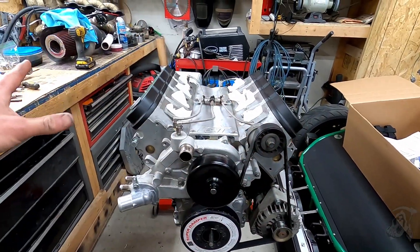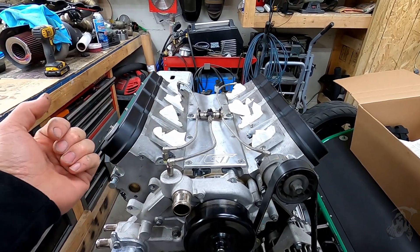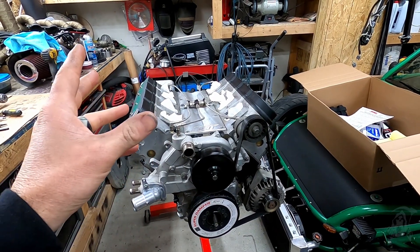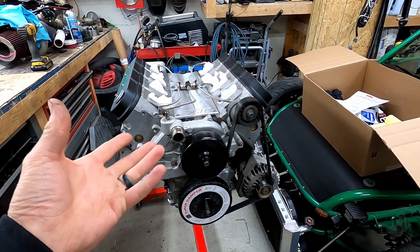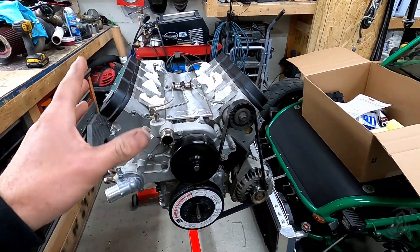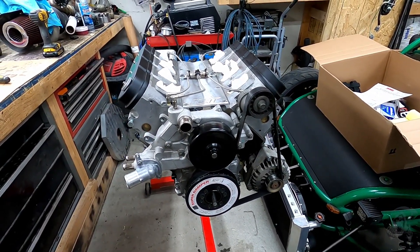All right guys, everything's done on here. I'm going to re-measure my push rods just to make sure they're correct because it's a new camshaft — things can change. Plus, I got new lifters. Next week I'm going to be putting this motor back in, so I'll have to do just a minor break-in. The piston rings and everything were reused, cylinder walls were good. The only thing new in there is all the bearings and the camshaft. So I'm just going to do a light break-in with some conventional oil and then jump straight to synthetic to get all the assembly lube out of there — and make sure there's nothing falling apart in the initial 50 miles or so before I change the oil. But other than that guys, thanks for watching. Please like and subscribe. Check us out next time.